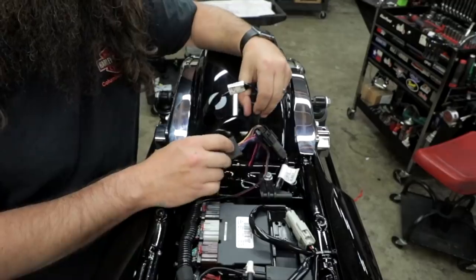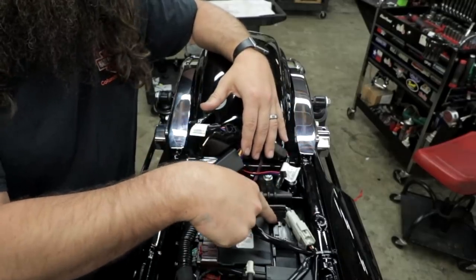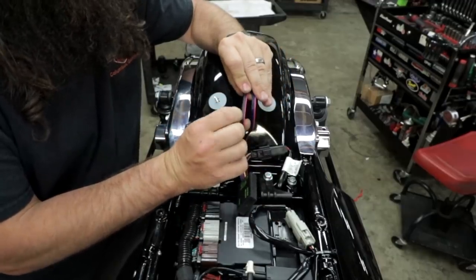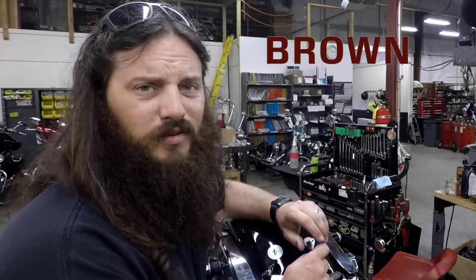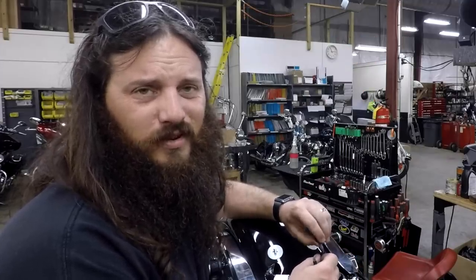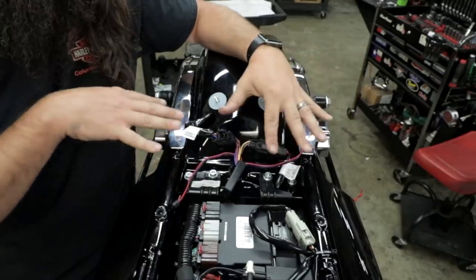On this particular model, this is your rear lighting connector — they're six-pin Molex connectors. The location is different for each model; a lot of them are right here in this empty slot next to the gray connector. These look the same but one has a brown wire in it. The brown wire is the right side — brown is a five-letter word, right is a five-letter word, that's how I remember it. Brown is always the right, violet is always the left. Now I'll bring my saddlebags over to see where these connectors are going to live.